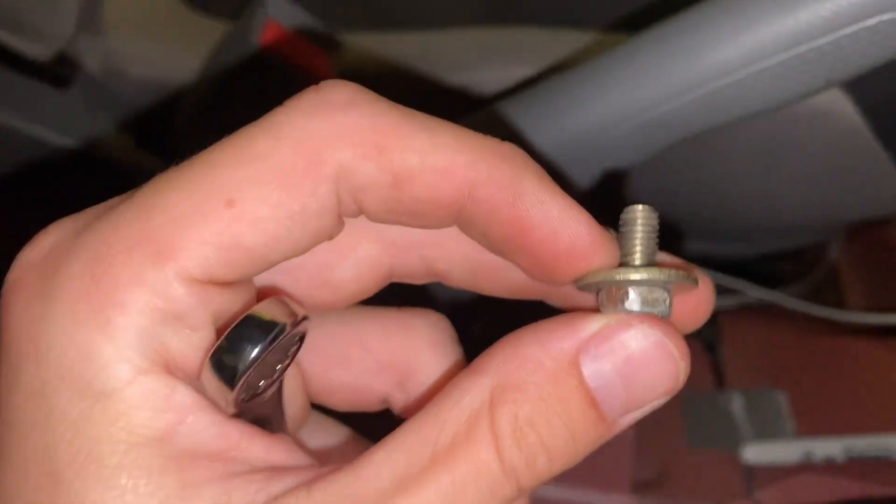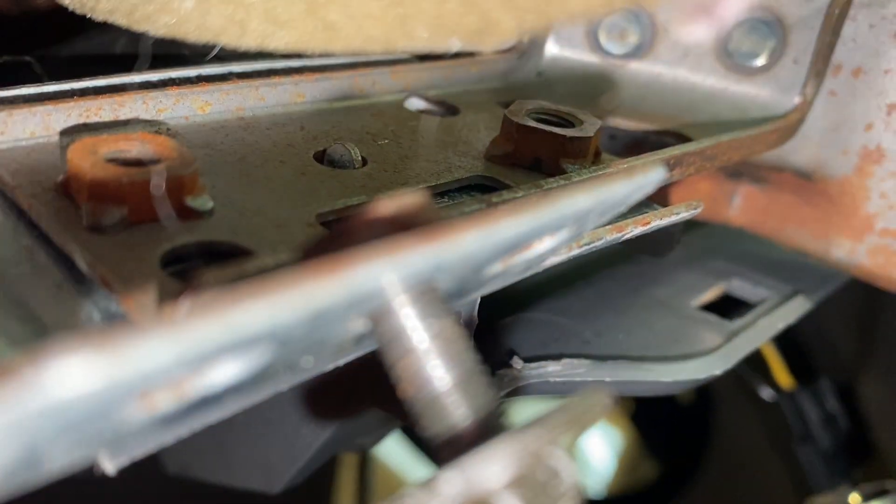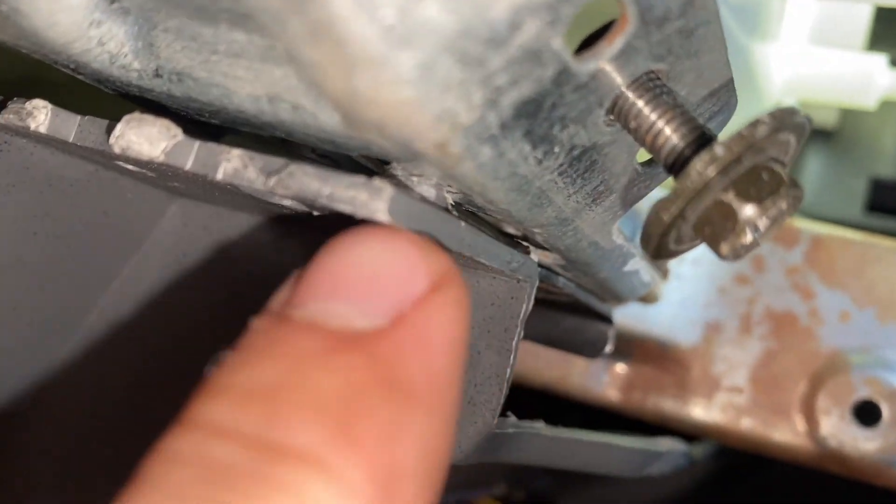So I just got out the 10 mil from this side. What you're going to need to do is there is a little tooth right in the middle there which kind of holds this in place. You're going to slide that out of the tooth and drop it down. It might take some wiggling around, but you will be able to get it. Just remember this silver piece is sandwiched between these two, so they both have things which are trying to help it stay in the same place, so it can be a bit of a pain to remove.